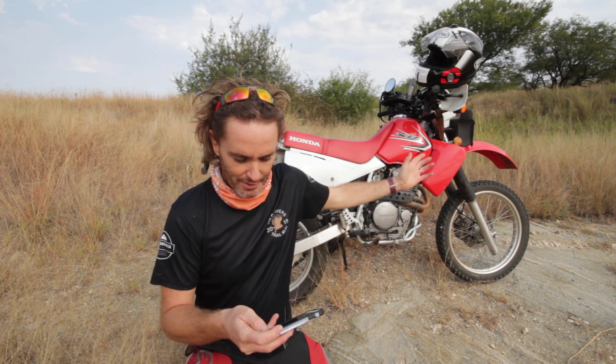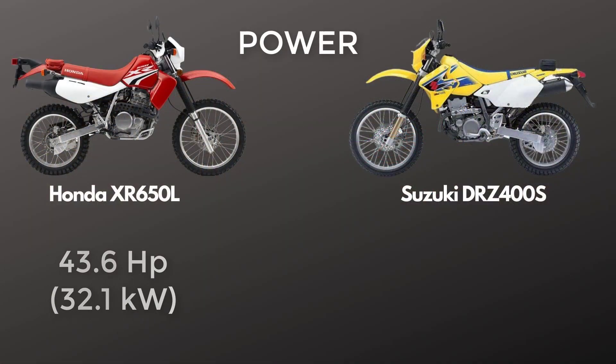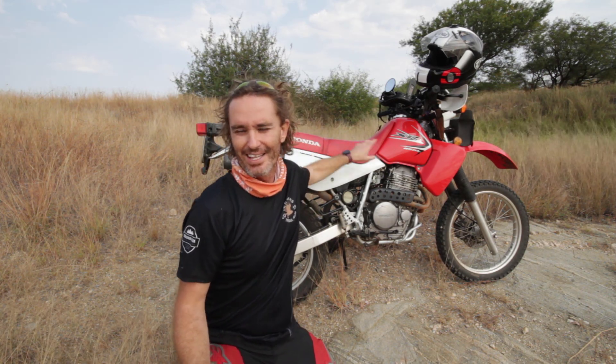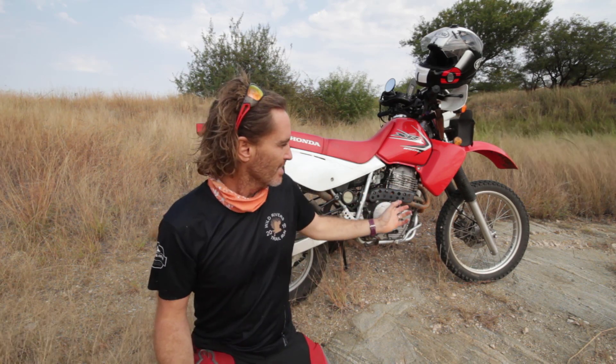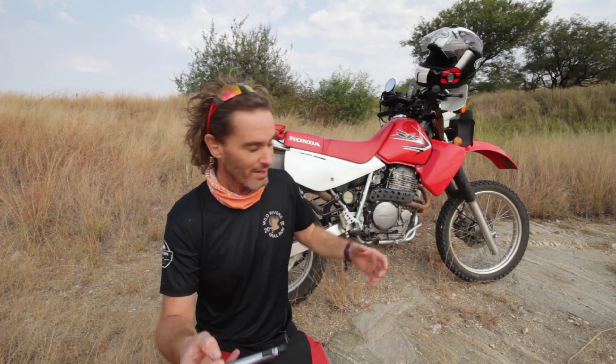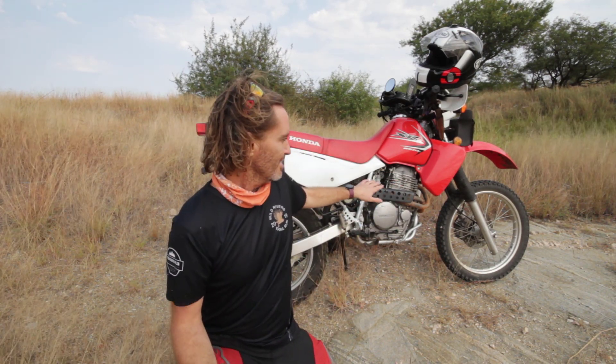The Honda's power is about 44 horsepower and the Suzuki is 39 horsepower — that's only a 12% increase, so 12% more power on the XR650L than the DRZ-400, despite the much bigger engine. Part of the reason is the Suzuki engine is more modern with a higher compression ratio of 11.3:1, compared to this engine's 8.3:1, so this engine would be less stressed than the Suzuki.